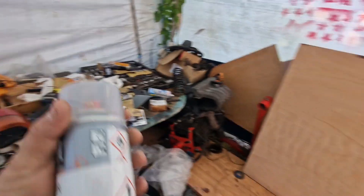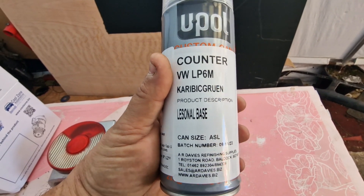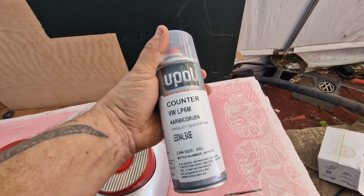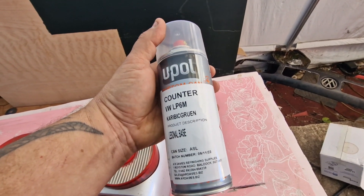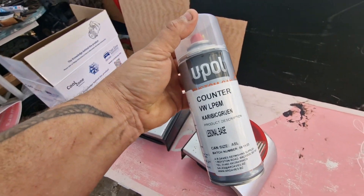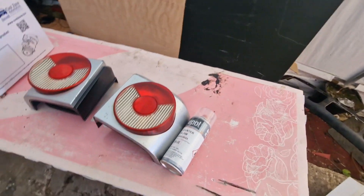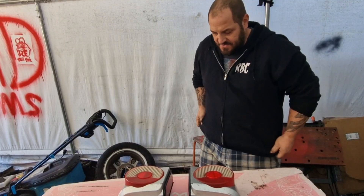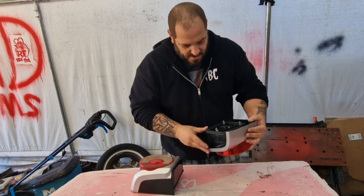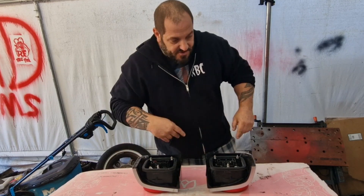So that is what's happening today — I'm going to be taking off these covers, sanding them down quickly, and then trying to paint-match them to my van. I've got the right paint code for my van, but the man couldn't scan it because of the linseed oil on the van. I think the paint's going to come out a bit brighter than my van because the linseed oil over the years has darkened it, so I might have to use some satin black to feather over and give them a sand to try and match the patina.